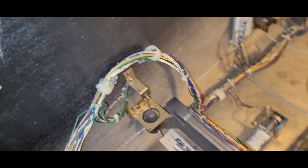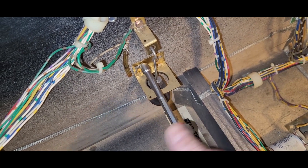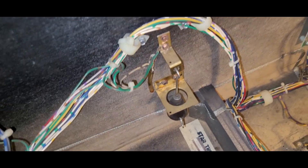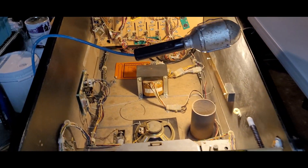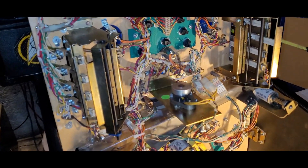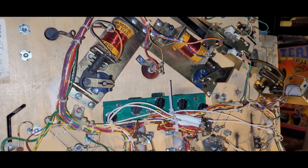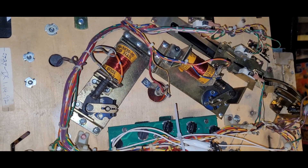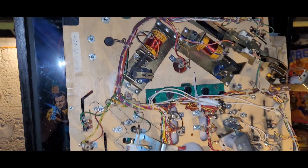That seems a little bit loose — let's crank that up just a little bit more. There we go, I guess I didn't re-tighten that one. I've got to make sure that connection is nice and solid. Tilt bob is happy. I set it to free play. The drop targets are working and the pop bumpers are working, so I think I'm going to leave them for now and focus on the most important thing, which is the flippers. That way if I do have anybody over tomorrow, we can play this game without these crappy old flippers, and I can deal with the drop targets and slingshots next week.